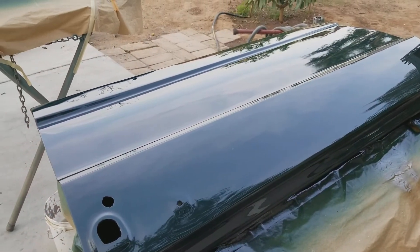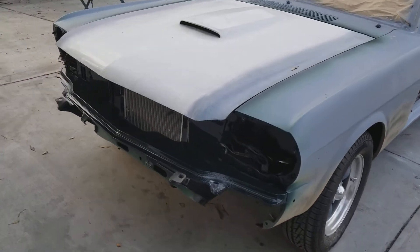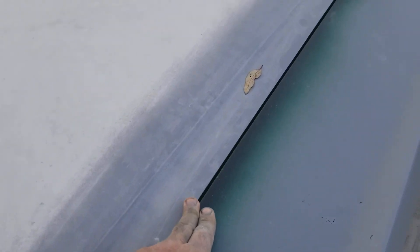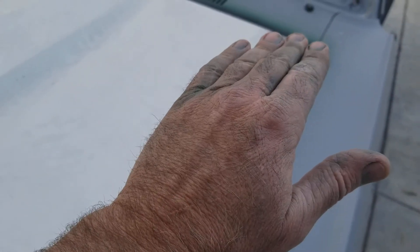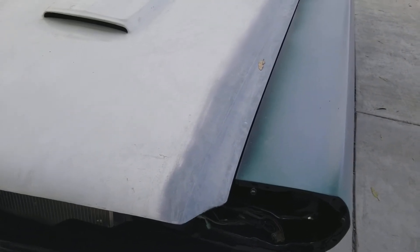That's all on the Mustang. Got the hood back on - I don't like the way this lines up very good. It's fiberglass, so we're gonna stack and put a shim underneath the back of it to kind of tilt it up so the back is higher, and when you lift up the hood it doesn't hit. We got a couple little things like that to do before we start the final sand and paint.